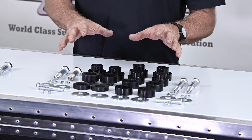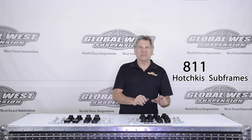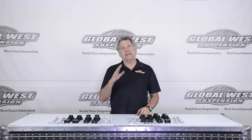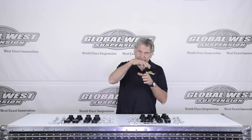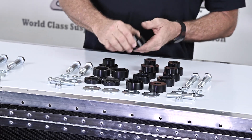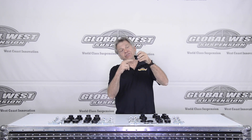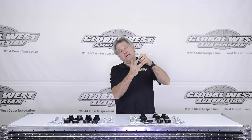On this side of the table we have body mount bushings part number 811 for Hotchkiss subframes. The big difference is ours goes around the outside of the frame, Hotchkiss goes in the center of the frame. These bushings — this would drop down from the top, the subframe connector would slide through here, this comes up and sandwiches the frame. The Hotchkiss subframe indexes here and they have a base piece that comes up, sandwiches the subframe, and then you have your bolt that goes through and locks it in position.